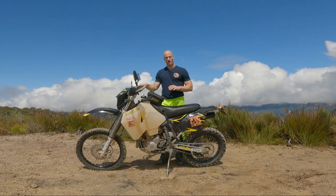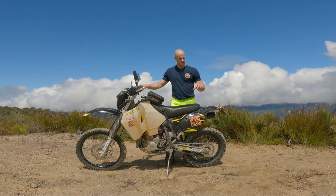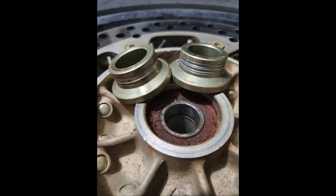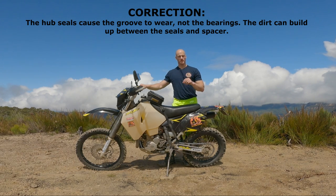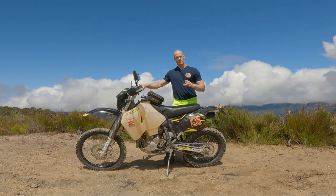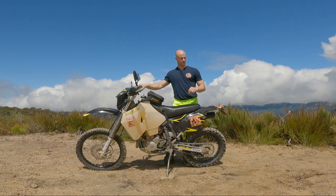Potential issue and problem number five — minor to some, but major if you're not keeping an eye on it — is your rear wheel spacers. If you don't pack them full of grease and regularly clean them, they can wear a groove where they sit on the bearings because grime will absolutely eat away at the spacer. They're only about a $50 replacement part, but the best way is when you're changing your tire, tube, or servicing the bike, pull them out, clean them up, and fill them up with grease so the dirt sticks to the grease. I've seen spacers nearly worn through. If you look after them, they'll last a lifetime on the bike.